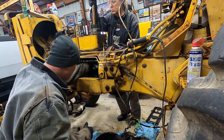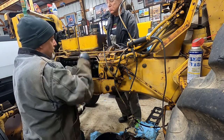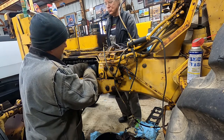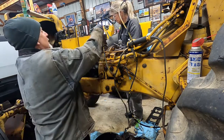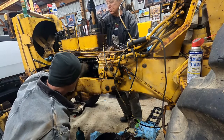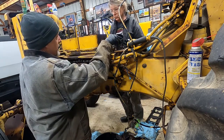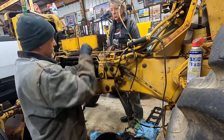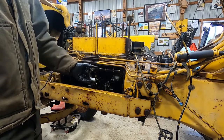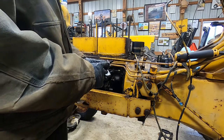Making sure it's lined up. Give it a couple more taps. All right, so we've got it tapped down. We're on the top of the crank, got the bottom. These have to fit on a certain way - on the top of this it's marked with a four for cylinder number four, and the piston rod should be marked the same way.